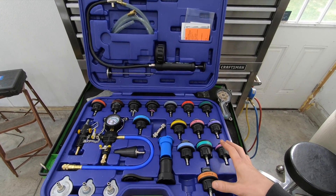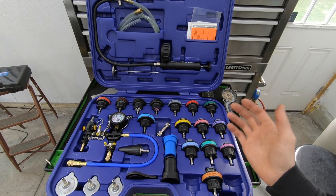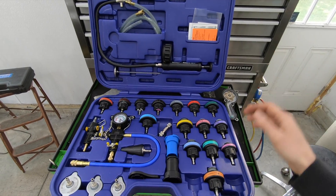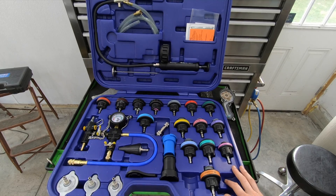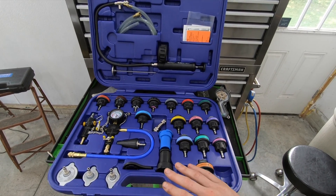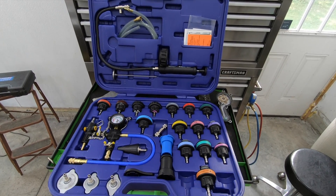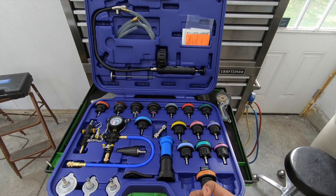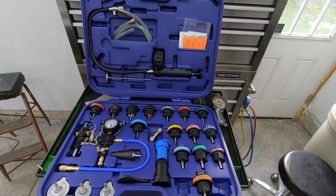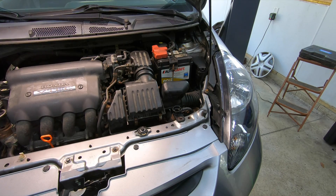It's not cheap - it's about $200 for the whole kit. But if you have a cooling system that is very hard to bleed and you take it to somebody, chances are they're going to charge you $100 just to walk in the door, so you're already halfway to buying this kit. The way this thing works is really sweet. It literally sucks the air out of the cooling system and then replaces it with coolant, so it's basically impossible to need to bleed out the cooling system after using this.